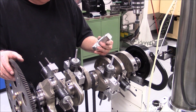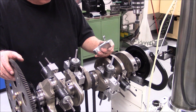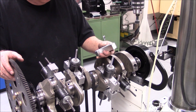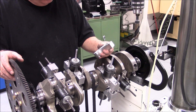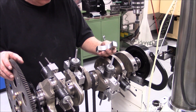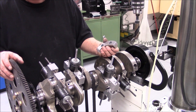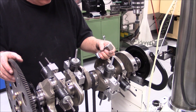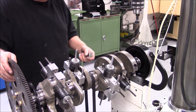This is our bolt-in counterweight that goes inside our harmonic balancer. This thing started at 433 grams and we got it down to 399. I would have liked to see more out of it, but still I think that's a good amount out, and this thing is actually quite a bit less weight than the factory GM balancer counterweight. So we've taken quite a bit of stress off the snout on this crank by doing this. Let's bolt it in and see where we come in at.